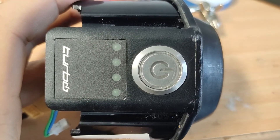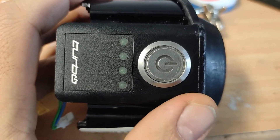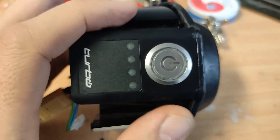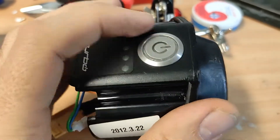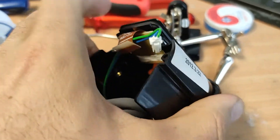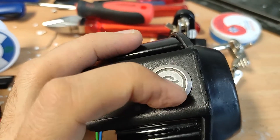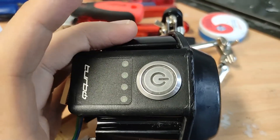Next I will remove the power button, because the BMS I'm using is always on when connected, so I have no use for it. I'll unscrew it and will probably make an adapter for the charging port to fit in its place.